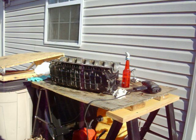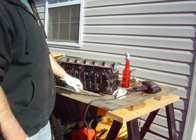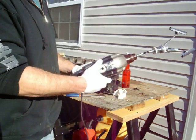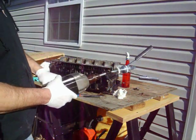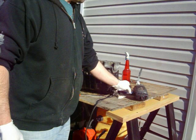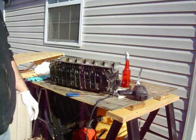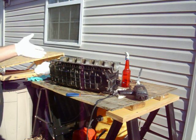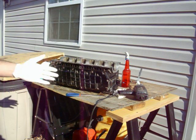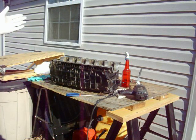That stuff is awesome for cleaning things off, and it smells nice too. After I did that, I got out the old power drill and had this hone hooked up. Being quite copious with Marvel Mystery Oil, I proceeded to hone each one of these cylinders in stages in sets of like 45 seconds — slow, nice good up and down pattern.